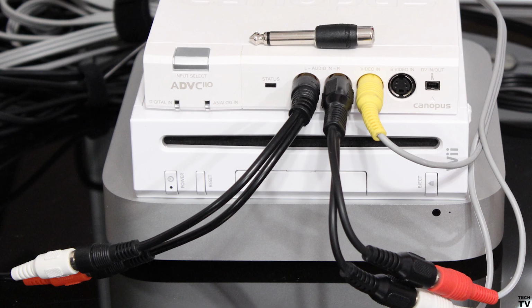Obviously, if you're live streaming, there wouldn't be any reason to go back and change the audio levels. I also know with OBS Studio, as well as a lot of other software programs, you wouldn't have to run your audio board right into the Canopus ADVC 110. It would let you select your external USB audio board as the audio source. This is really for people doing tutorials for the Sega Genesis, the Nintendo Wii, or any other gaming console that uses composite or S-video.